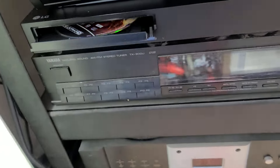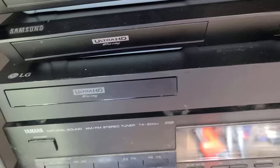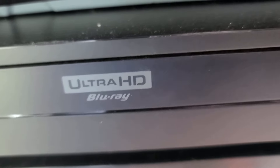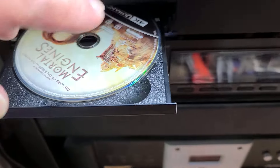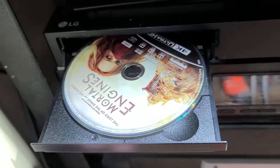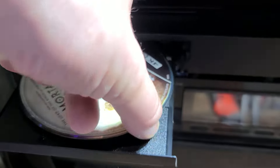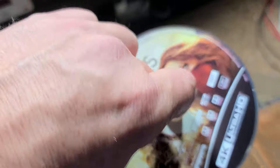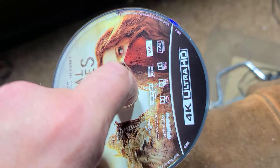Catus Maximus here. This is the issue we're fixing, and it happens with all these cheap 4K players because they spin the disc at up to 5,000 RPM in order to achieve the data rates to transmit that 4K signal. These 4K players are really made especially cheaply so they can justify even making them at all. The root cause is the disc — the heavy ink printing is not perfectly centered, and there's a significant amount of weight. When it spins at 5,000 RPM it starts to develop a resonance.